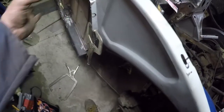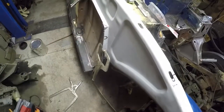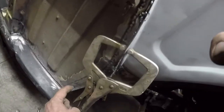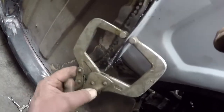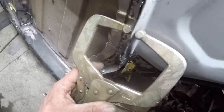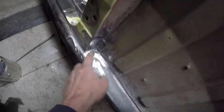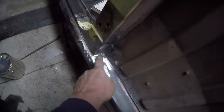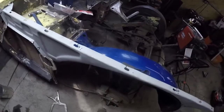That goes in, it's a baffle plate that goes in on the inner front fender. You can see where I've spliced in right in here, and I've got the nuts already welded in for the baffle plate right in here and down there. But just trying to get that thing straightened out, because I've got my stiffeners in down here off my A-post. They're just slightly ground. Man, this thing's just a freaking weird thing for layout. Hopefully it works out good.